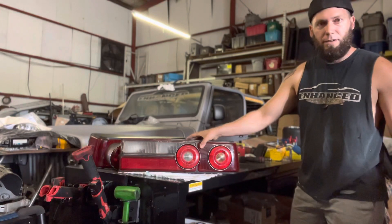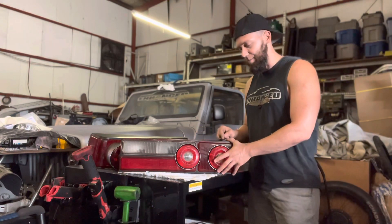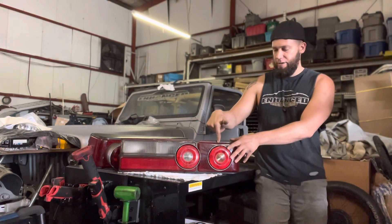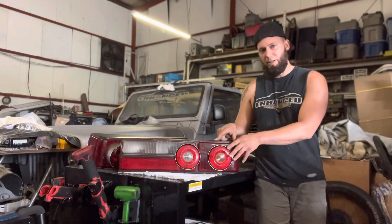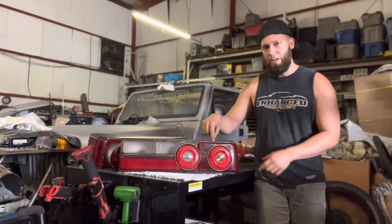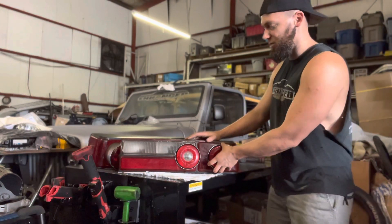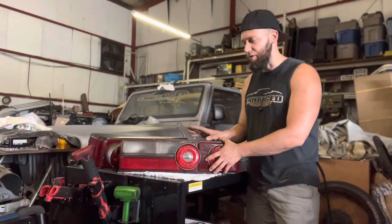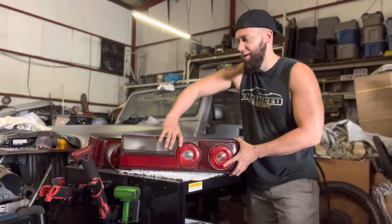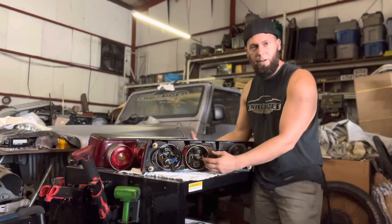When I actually go to permanently mount these things — good angle there — I'm probably going to pull it apart, the lens and the housing. I'm thinking I'm going to fiberglass it from the inside because the outer shell behind the lens isn't really necessary for anything other than holding the light. So that's what's mounted to this — I think I'm going to fiberglass that to the lens on the inside, keep it all in there, and it can look as ugly as it wants to on the inside. Do a couple layers of fiberglass, make sure it's nice and strong.